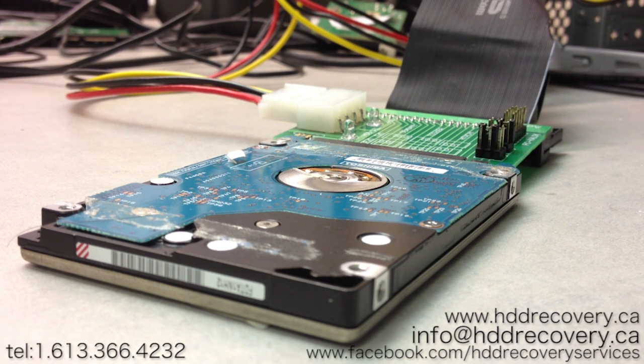The problem we're discussing today is relevant if you feed power to your drive, put your ear to it, and hear a buzzing sound — and it's a Toshiba drive. That buzzing sound means power is being fed to the motor, but the motor is physically being prevented from spinning by the failed bearing. The fluid inside the bearing, over an extensive period of time, becomes an almost gummy-like substance and stops providing lubrication, causing the drive to have issues rotating.